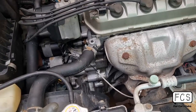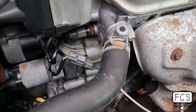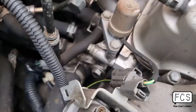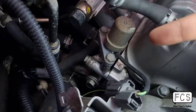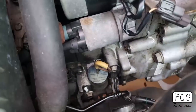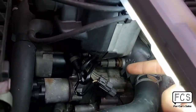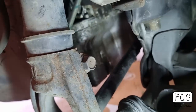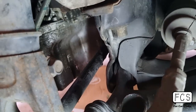It's been exactly one week since we washed the engine bay, and have a look at this oil just coming down right here. This is why we need to degrease the whole area in order to track down an oil leak. Pretty much straight away — and hopefully you can see it on camera — quite a bit of oil is coming between the head and the VTEC solenoid, all the way down towards the gearbox as well as the front of the engine. Originally I thought maybe the oil pan gasket is gone, but it looks like it's all from up top.